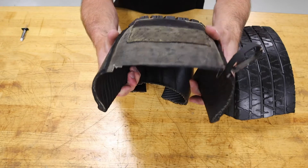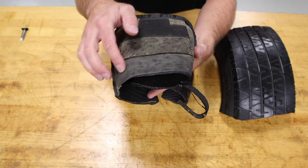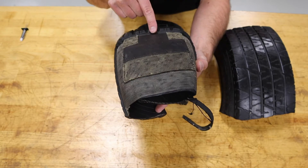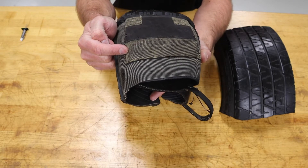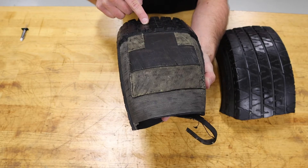The structure for the tire itself then comes from these radial plies. Once we've established that, we then build other plies on top of it with different materials like nylon type materials, fabric type materials, steel belts, and ultimately we get up to the tread of the tire.